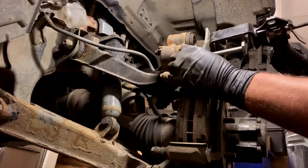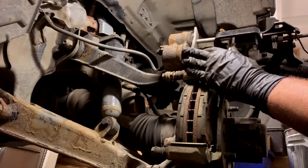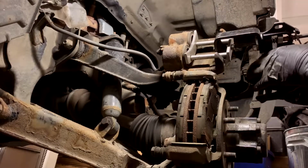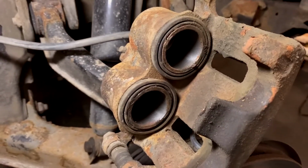Basically, you just put it on there like that, slap her forward, and then you squeeze her with your wet noodle grip. Cut the camera so that somebody else can come do it, somebody who's strong. These ones don't seem as bad. The other side fought me the entire way. Once it bottoms out like that, no need to keep reefing on her, bud. And just like that, your caliper piston can relate to you because it is also depressed.